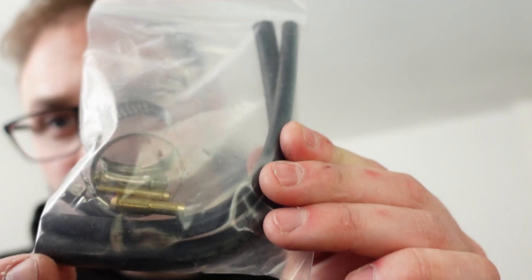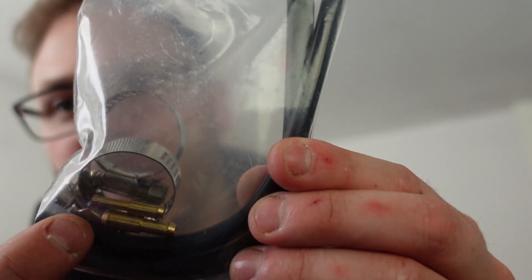I was doing some testing with the piping because the top piece seems a lot bigger than the one on the car. Luckily the piping on the car is a bit brittle and the kits come with tubes and adapters to go from a bigger tube down to a smaller tube, so we'll just use the new tubes. That saves the old brittle ones. We also get two clamps per diverter valve — one on each side — and I can use the other clamp to secure the printed caps blocking the other end.